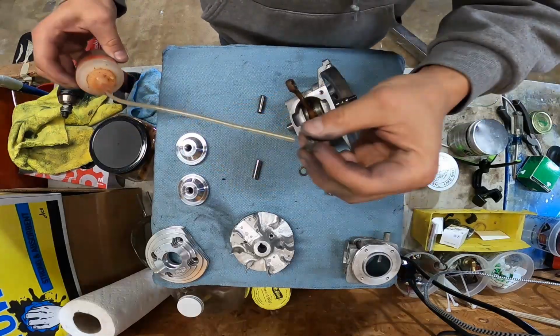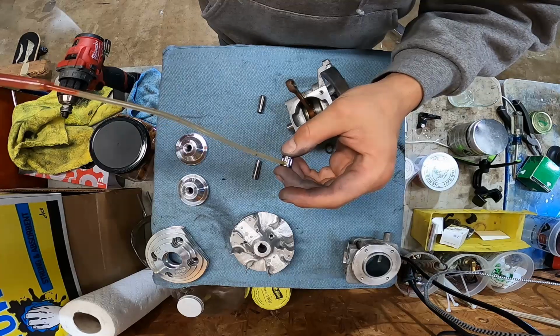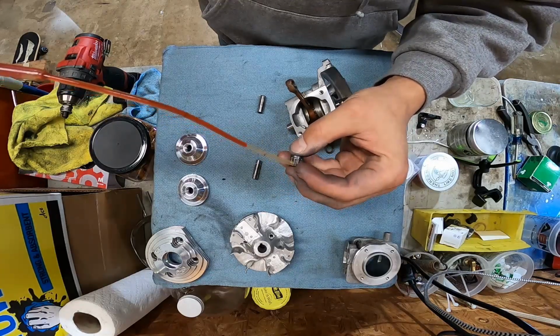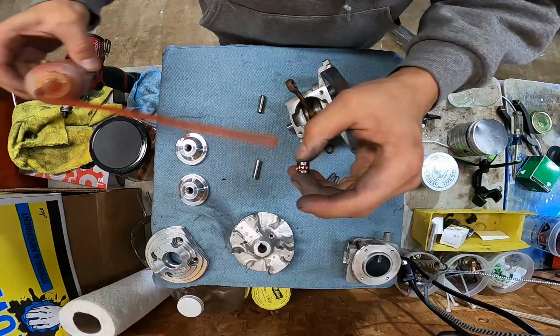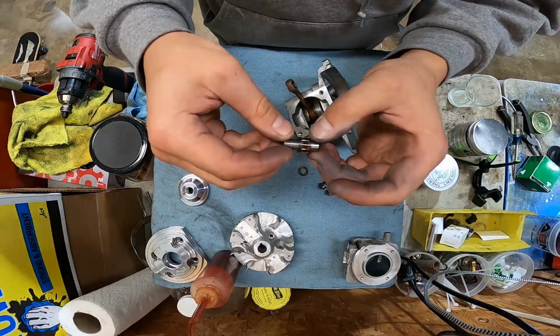In this little squeeze bottle, this is Model 800. It's their road race formula. I don't like to use the off-road formula unless it's in an off-road vehicle. The reason being is dirt bikes and stuff that are off-road, rolling trails and stuff, don't see the same high RPM abuse that things would when there's pavement.